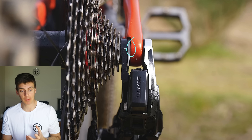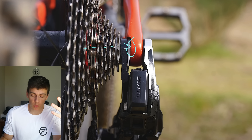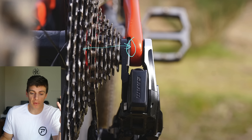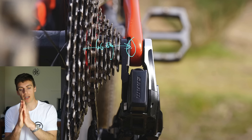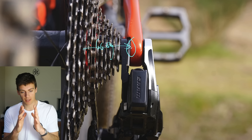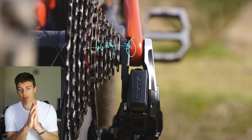That is just an absolute clanger. If that gets twisted in torsion it's just going to eat the soft carbon. But even if it doesn't — every time you apply axle clamping load, maybe M12 at 15 Newton-metres, you're probably looking at about 600 kilograms — every time you put the wheel in and out of the bike, those teeth on that serrated washer are just going to eat into that carbon dropout. And once that changes, your shifting datum moves, so your gears aren't going to be indexed anymore.